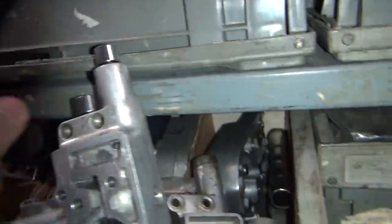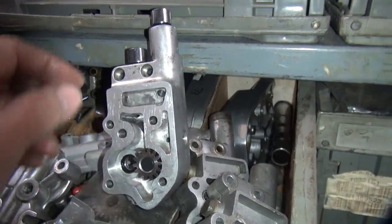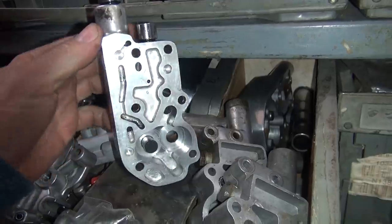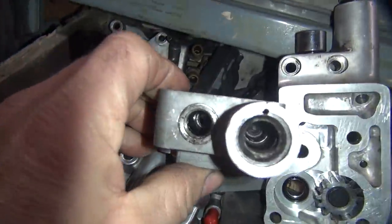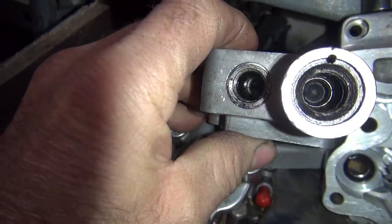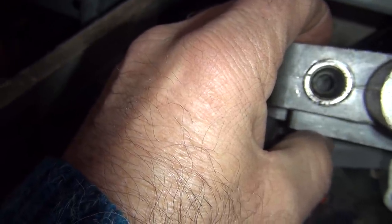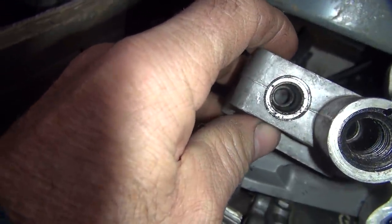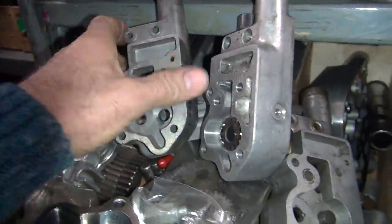This is a pressure feed system. Over here is the check valve, so the oil tank doesn't drain into your pump. When it drains into the pump it fills the pump up full of oil, comes out the holes, goes through the rest of the bike, fills up your case full of oil - then you have an oil problem called wet sump. This check valve is what prevents that. There's a hole way down in there, and that's a check ball that goes on there and seals. Now when there's any kind of a nick or a hair between the ball and that seat, it leaks - and when it leaks, it fills up the sump, fills up the pump, and goes into the motor.